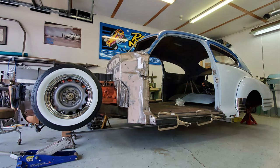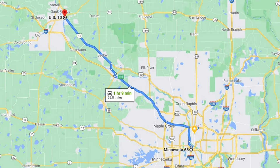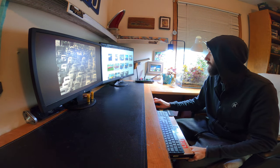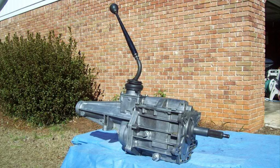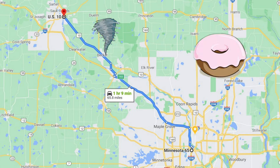After more consultations with Craigslist, I found a transmission for sale an hour north of me. I had been doing research every day for weeks and settled on a BorgWarner T5 manual transmission out of an S10. This fit my needs for many reasons: they are easy to find, relatively cheap, have a small footprint, and the shifter is in the middle of the transmission so it will clear the bench seat in my Fleetline. On my trip up to St. Cloud, I narrowly avoided a tornado and ate a couple of donuts, so I got that going for me, which is nice.